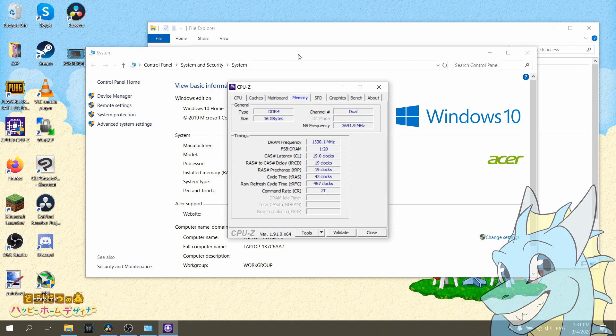I already did a quick test on the applications that were lagging a little and where FPS were not as high, and believe me — the difference in this model between using 16GB of RAM in dual channel versus 8GB is night and day. If you have the 8GB model, I would really suggest you get the extra 8GB so it can become dual channel.